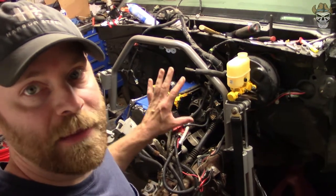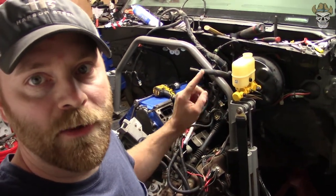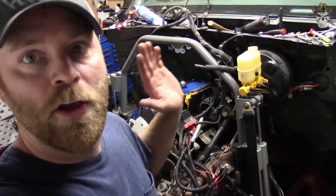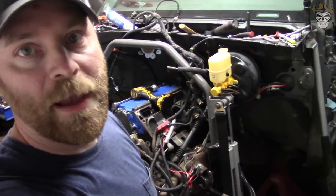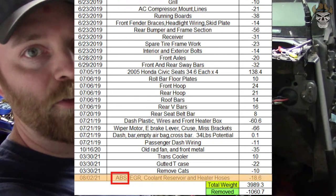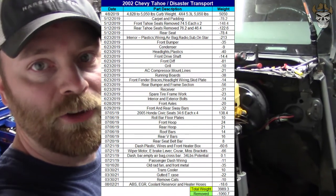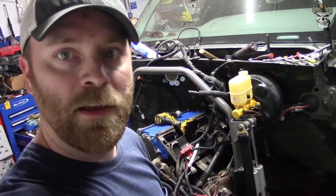The front brakes are all done. I'm not going to fill the reservoir yet because I still want to do the rear brakes, which will go straight from here to the back — right now it goes from the master cylinder to the ABS unit and then to the back. In the next video we'll be eliminating the ABS unit and seeing how much it weighs, since that adds to our weight reduction, as well as finishing up the brake lines. Hopefully you guys enjoyed the video — like, comment, share, subscribe, and get back to work.